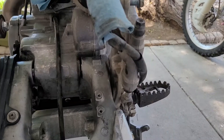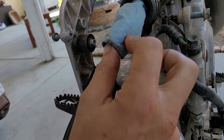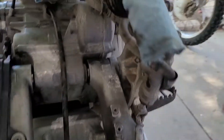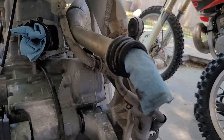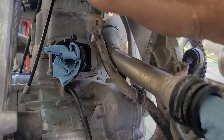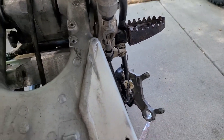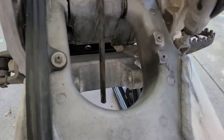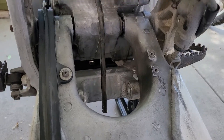We'll do something about mounting the wheel and some other tips. I've got some tips about bleeding this rear brake, because of the way this little loop works right there. You can get air back into your caliper, especially if you let your master cylinder get a little low. That's real common with my kids — when they're crashing, the bike topples and gets some air in it, the fluid goes back on top, and that air eventually gets sucked into the hose, giving you spongy brakes. We'll cover that later. We'll also go over the pivot links. Subscribe, like, and let's get out there and start riding soon guys.